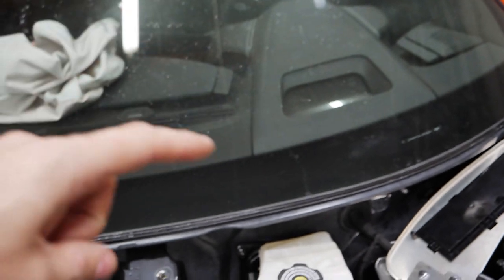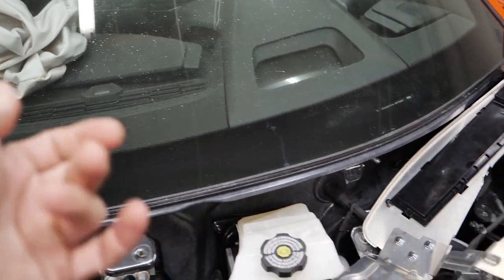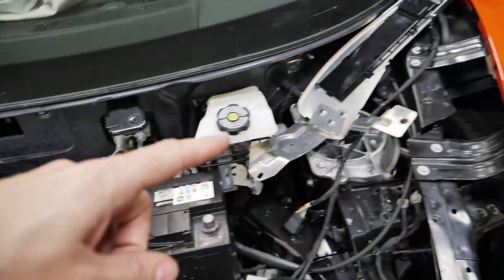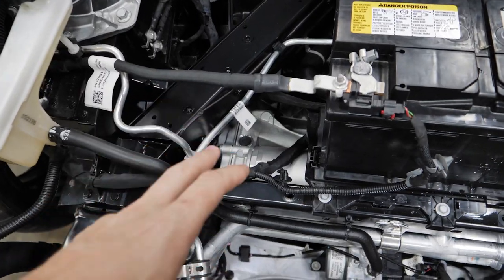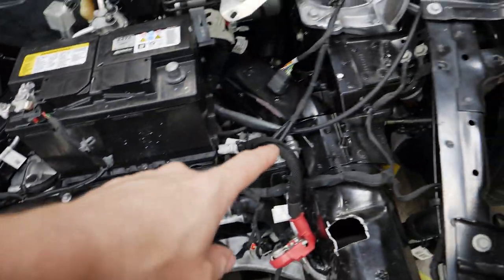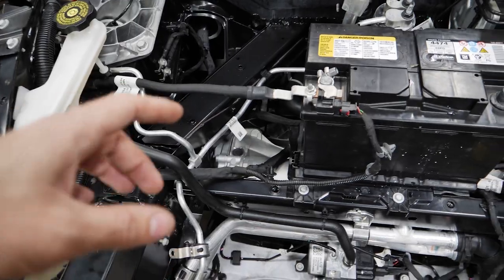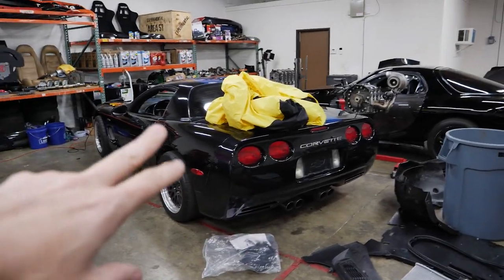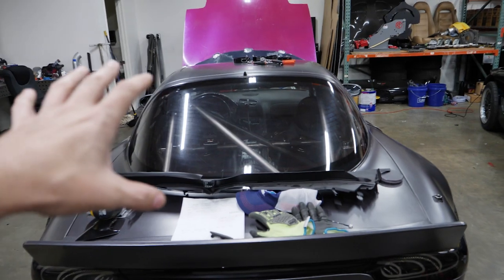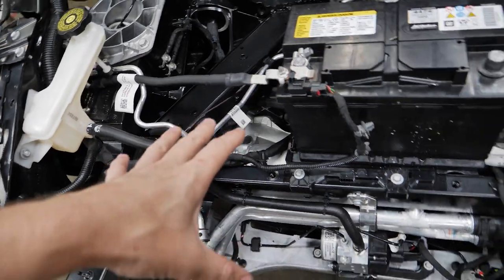The cool part about that is the pedal has its own force feedback mode, and we'll have some fun playing with that. So if we have brake-by-wire, we also have drive-by-wire, which is phenomenal for what we're going to be doing — it simplifies trying to run a cable to the back of the car. We also have electronic power assist built onto the steering rack, so we don't have to have all these random accessories on the rotary engine, which makes this swap that much easier. Power steering on this car is so amazing — having this insane monster with power steering is one of the greatest luxuries I've ever had in my life. So we've got electronic power assist steering, which means we just have to worry about a good alternator, and that's one of my specialties.